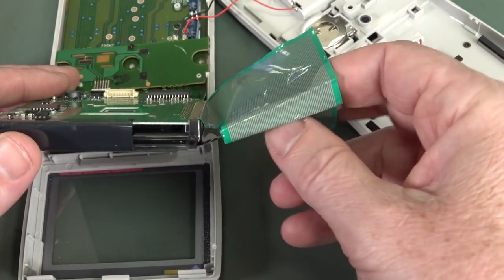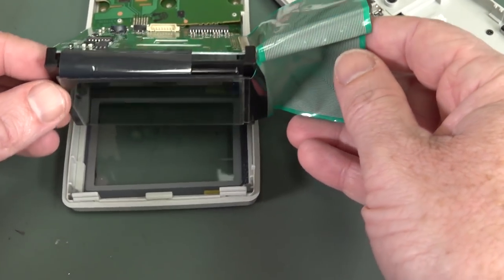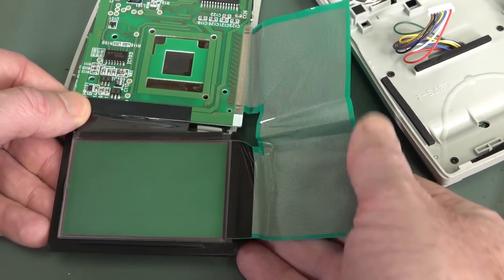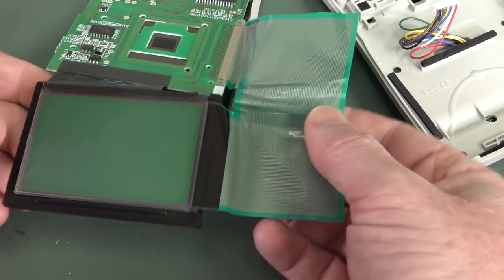Take a peek under the hood here — this is actually a big cutout in the PCB, all that's cut out, and a big hole in the bottom. That's the back of our main big-ass processor on that board. This is terrible, Muriel. Look at this — we've got our hot bar ribbon attachment, and there's no length to get that out, it just goes vertical. So they've just got enough lead length on there to assemble these two boards as an assembly before they screw it in. Someone wasn't thinking when they designed this for assembly. And that ribbon cable is just hilariously long.